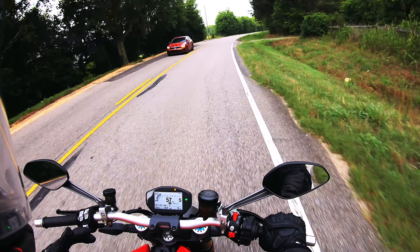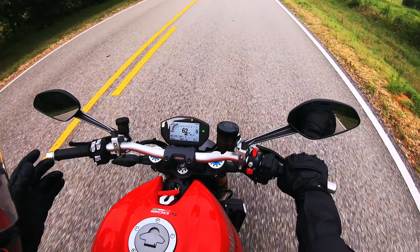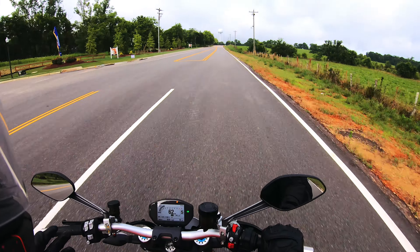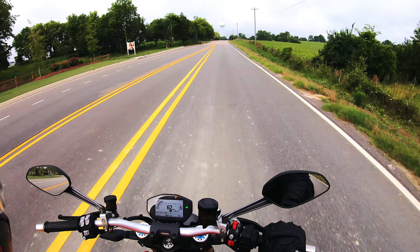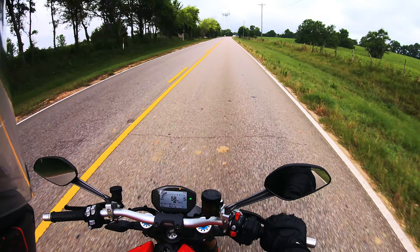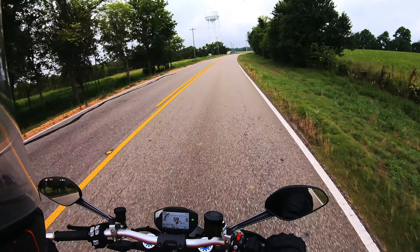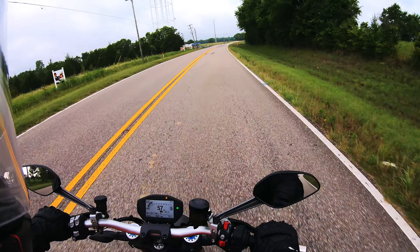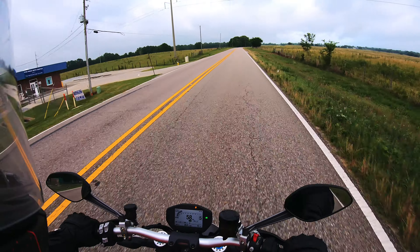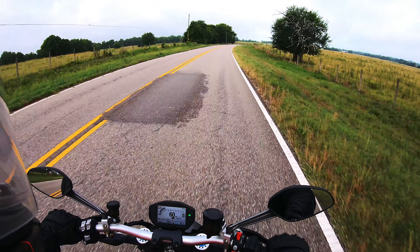I put my actual settings at the top of the video. I did this a year and a half ago so I'm not 100% sure of every number, but I do know the rebound and damping on sport settings is 4 clicks out versus the factory standard of 12. I went out for a ride and it was just too rough. The roads here in Alabama — this is a fairly nice road but you really can't see all the dips, bumps, heaves, and patches. They're big on patching rather than paving, and the patches just make the roads less than fun.